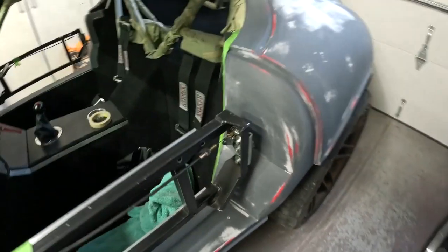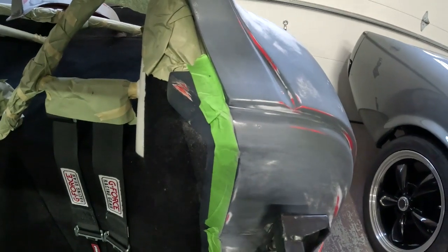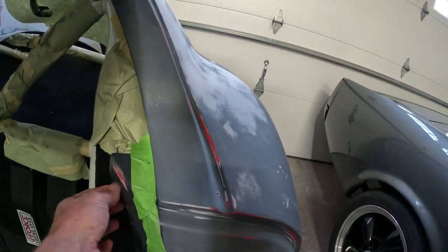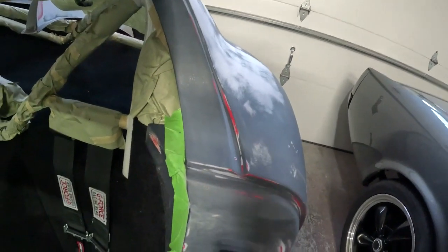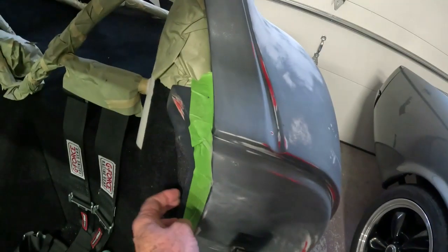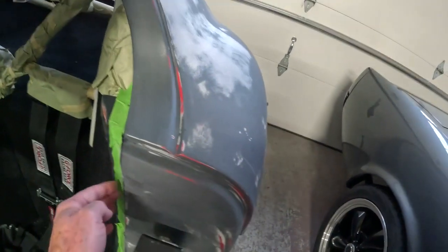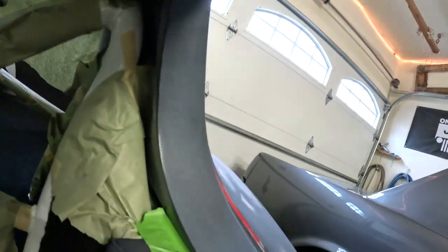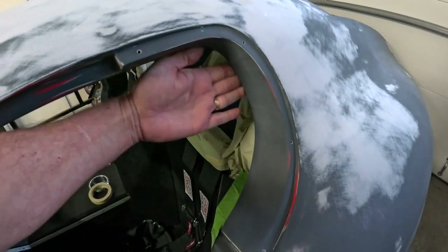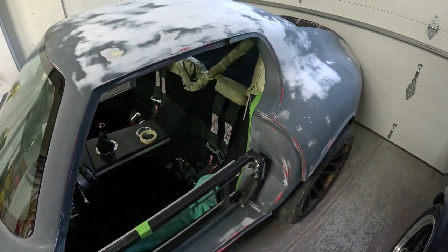Here's another question — I'm debating the area where the seat belts tear up into the top of the glass. I'm actually going to put a piece of aluminum over there because whatever I paint there is just going to get torn up. I'll make an aluminum plate and probably adhere it with 3M VHB tape. I'm going to leave the inside in gray so it kind of matches the carpet, then draw a sharp line — it'll be blue from here over, rather than going back into that area.